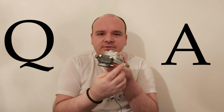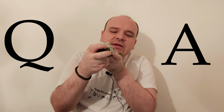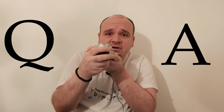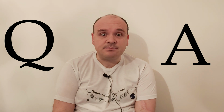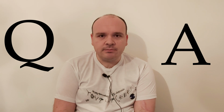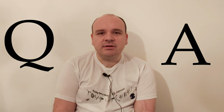The second multimeter should be attached to the EHA here on its ports. So you just pull just a bit the connector for your EHA, and you stick here your multimeter and get the connector back. And then you will have to measure milliamps and select the lowest range, because as your car is warm on idle, you should get between -3 and 0 milliamps.